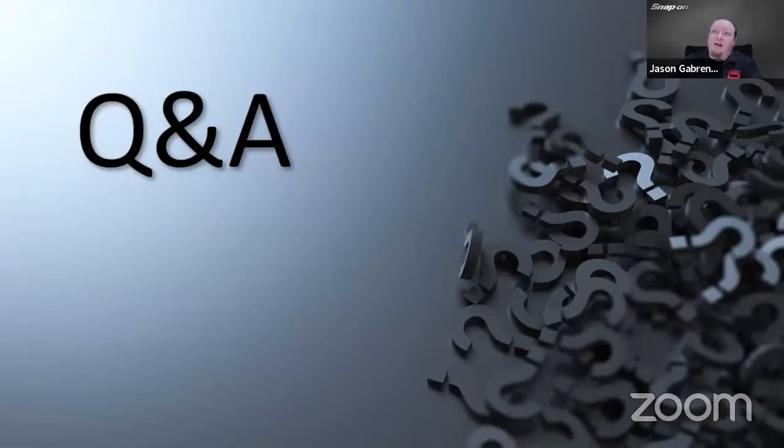Going back to the beginning of chat: I am Smiley from Vancouver Island, thanks for checking in. Quinn mentioned the VATS system — GM's 1 through 15 resistor pellet embedded in the keyblade. Nick is joining from London, England at 11 o'clock at night — always a trooper. Quinn asked what Snap-on scan tools have key programming capability — it depends on the manufacturer. If it's easy enough to integrate with the scan tool, we do it. If the manufacturer makes it exceedingly difficult — like requiring you to log into their website to calculate a value — it won't work. If it's just a PIN code, you can often just plug it in and it works.